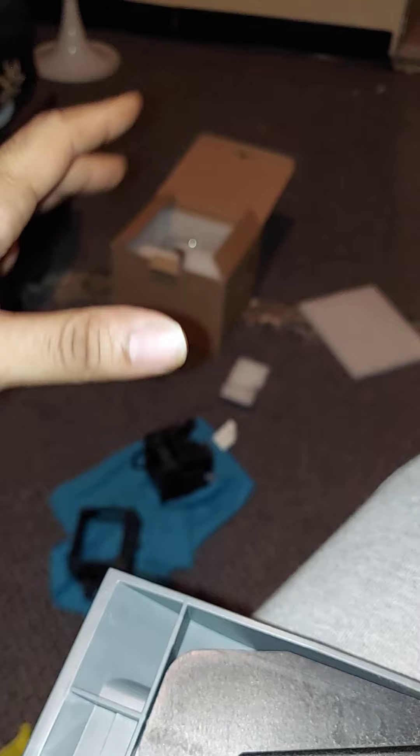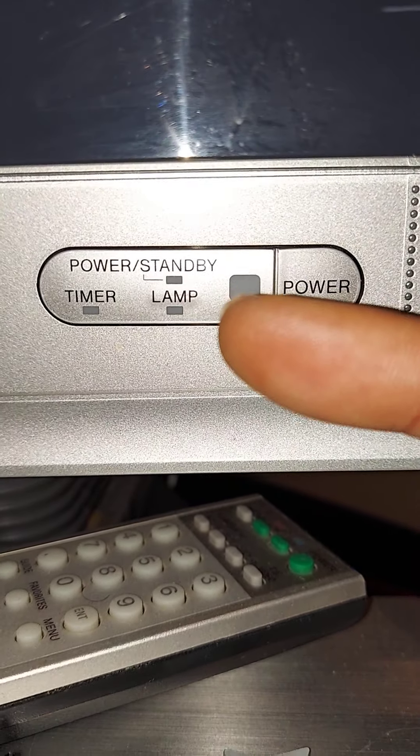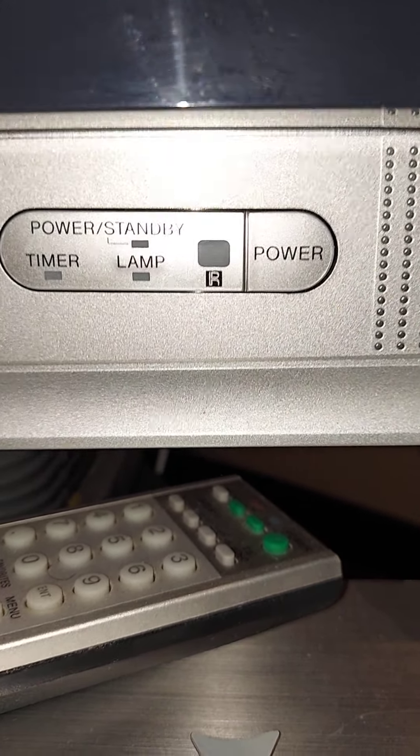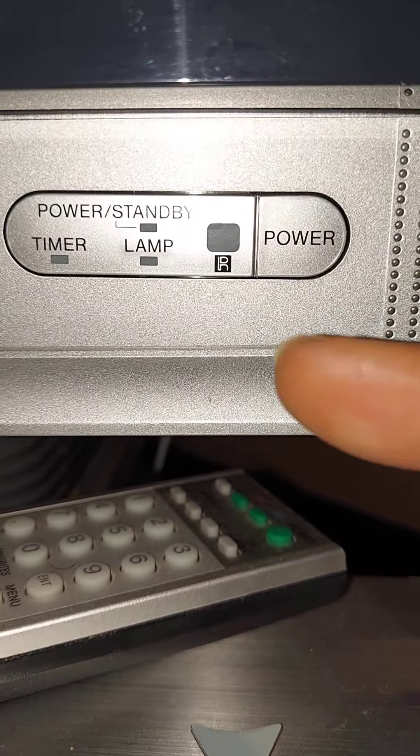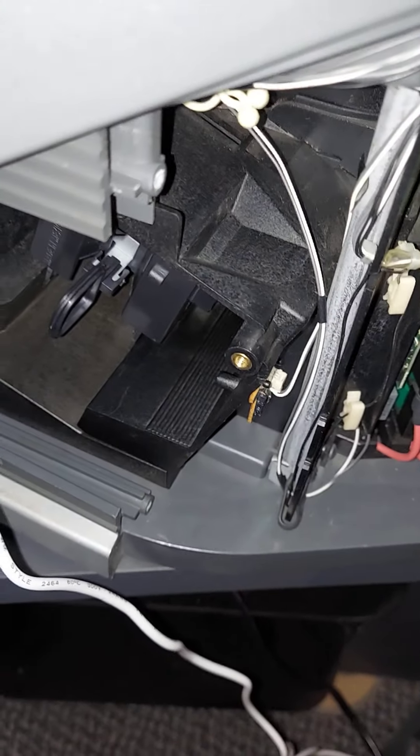You've got to be careful of that. It's easy to take the light out — there are five screws total and that's it. Now here's the situation: when you turn the TV on after putting in a new light, if you get the three blinking red lights, we already know most likely that is a sensor issue.